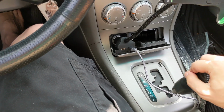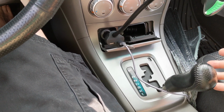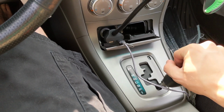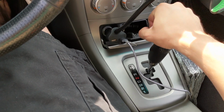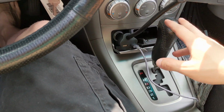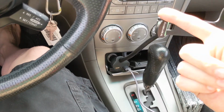I'm going to go through all the gears and kind of wait there for about 10 seconds. And once I'm done all the way down at 1, I'm going to do everything in reverse. So I'm going to pop it back into second, wait, third, wait, drive, neutral, reverse, back to park. Once I'm done with that, then I'm actually going to take it for a drive after I recheck the fluids